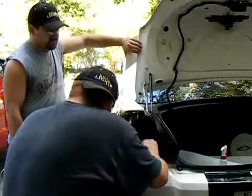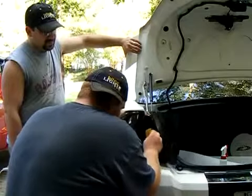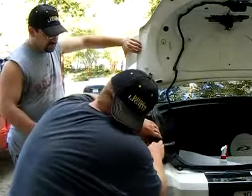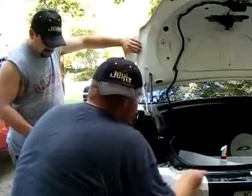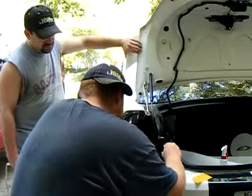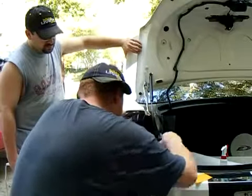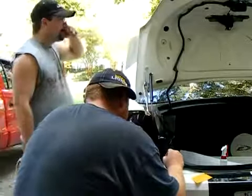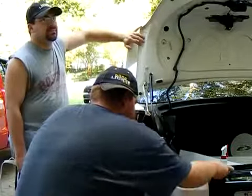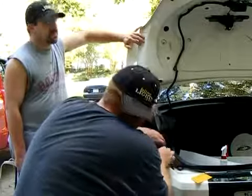Being that this taillight is fairly contoured on every angle, take this and wrap it around the edge of the taillight. You might have to make some relief cuts on the tint, make it easier to move it and do what you gotta do with it, especially in corners.